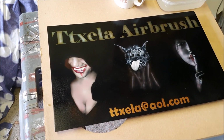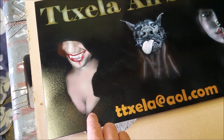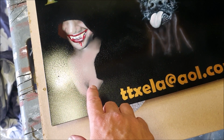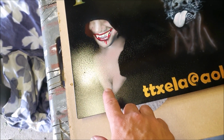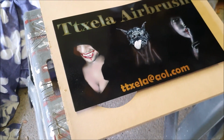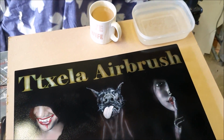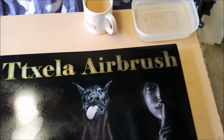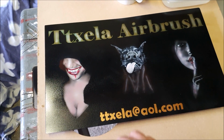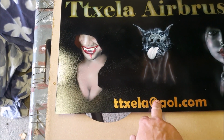Well, it's a few days later and I'm going to have a go at flattening this off. You can see in the light it catches, we have got a fairly strong orange peel effect. Obviously I'm trying to catch the light to show it at its worst. From a distance, it didn't look too bad. But I'm going to be flattening it off, starting with some 800 grit paper and then working finer, trying to get rid of the lumps and the bumps.